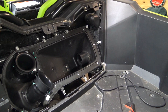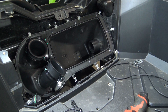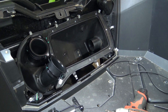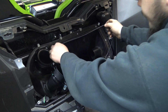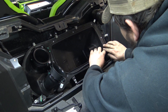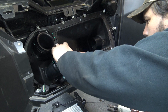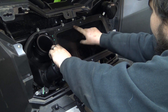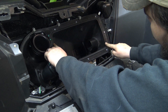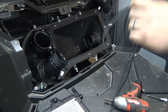It does come with this gasket and this gasket. The small one is going to be for the square, and this big one is going to be for the cover we took off. I've noticed putting different gaskets like this on, if you just start here and push it around, by the time you get to the end you've got extra. So you're better off getting your corners done first, and then do your straights — then everything lays in pretty good.